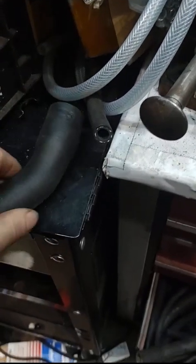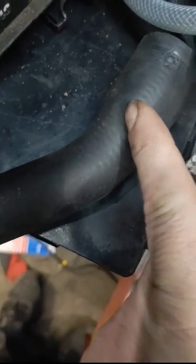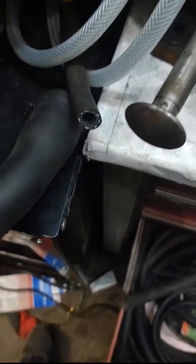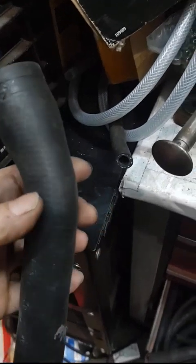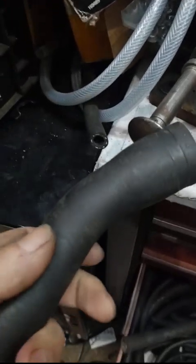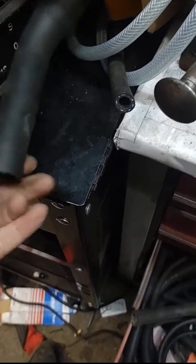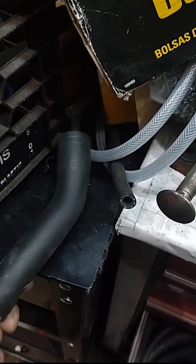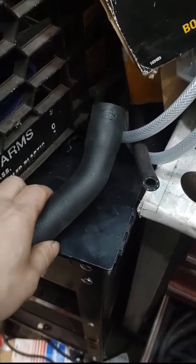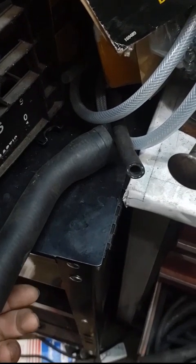I found this in my drawer - it's a 45-degree bypass hose. You cut it right here, really short, so it starts to turn right away. Something like this - you go to your auto parts store, ask them to look in the back, and find what you need. Or get the part number and cross-reference it to Rock Auto and get it cheaper if you have the time.